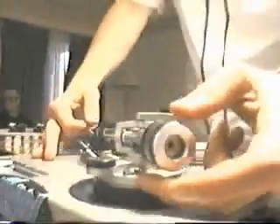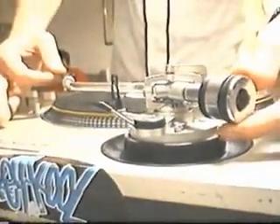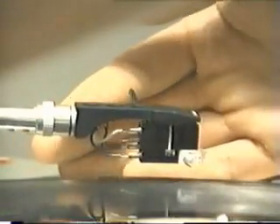One of the things I like to demonstrate is how to properly zero out and add weight to a tone arm. So if you have a three and a half gram weight, you know that you have precisely three and a half grams. In traditional turntable fashion, what we want to do is pull the counterweight all the way back, then slowly add weight until the needle just floats above the record by itself. That's our zero balance point.